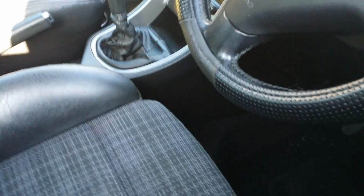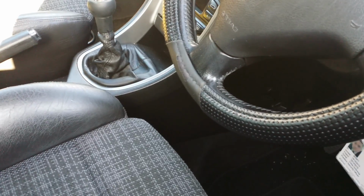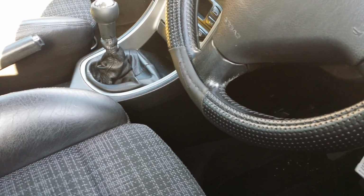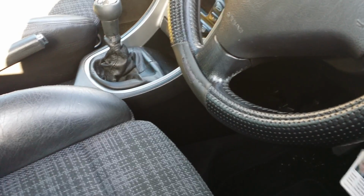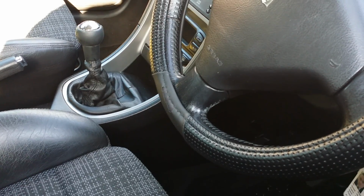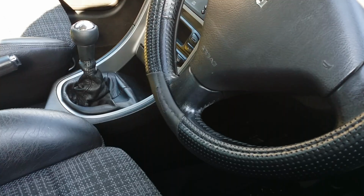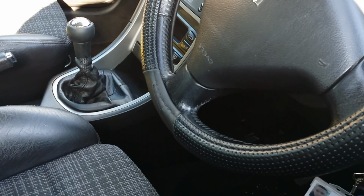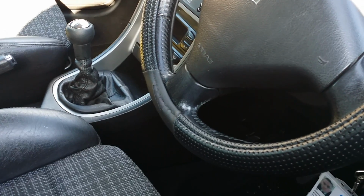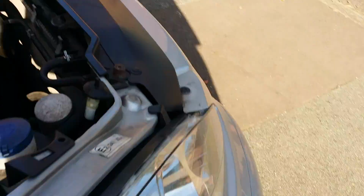As I say, just turn the ignition on, get some fuel into the filter before you start it. Just turn it on and off a couple of times, maybe, probably say 5 times or so, just to get the fuel in, and give it a few more turns. And get that fuel in there. Right, give it one last turn. And there you see, firing up.